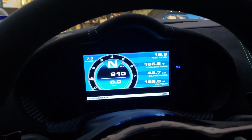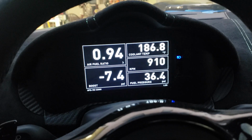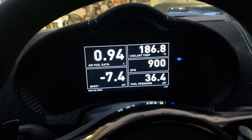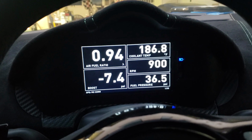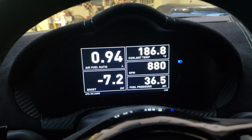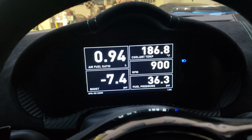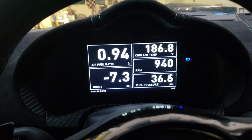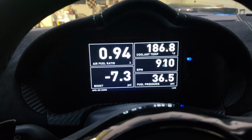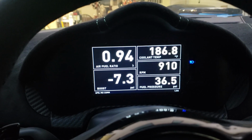It's got RPM, what gear you're in, miles an hour, oil pressure, coolant temperature, all the basic stuff. And I haven't really finished configuring all of this. I'll show you how I'm switching between these screens, but I'm playing around. This might be my drag race screen where I've got much bigger numbers, ones that are important. I'm going on the track. I need to have RPM so I can launch the car, but I've got the shift lights across the top, so I don't need to know RPM that much, but maybe I want to keep an eye on my air-fuel ratio and my boost pressure. So maybe this is what I have for drag race, and I can reconfigure this.